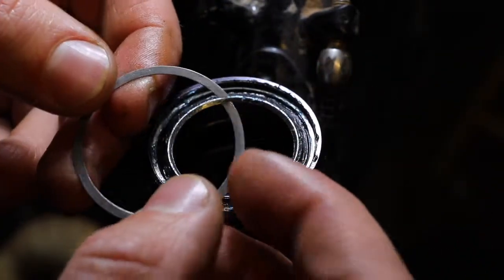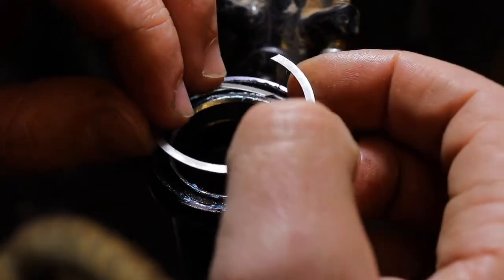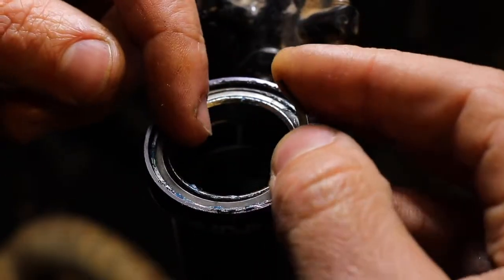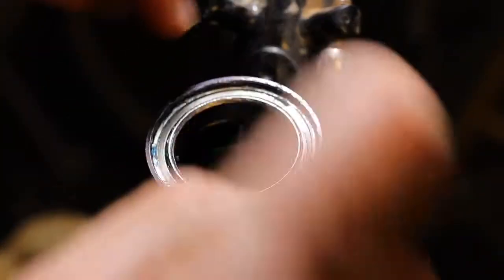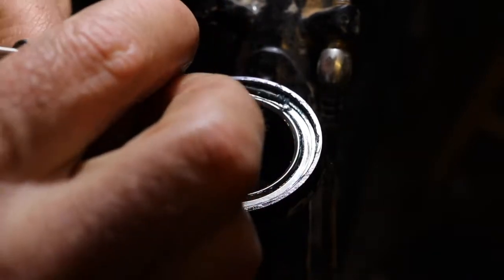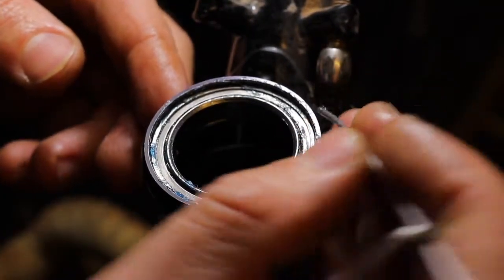So when you go to put your snap ring back in, locate the section of it that points outward, stretch the ring slightly so that that section is down, and work that into the groove. And go laying the snap ring down into the groove all the way around till you get to the end, and then give it a little shove and it'll settle down in there. You can just look for that gap between the two ends, and that tells you if it's settled down in there enough. You can also check to make sure it's a clean curve.